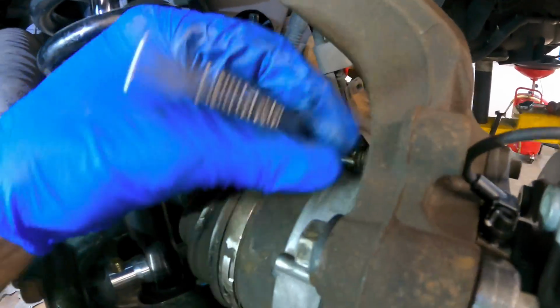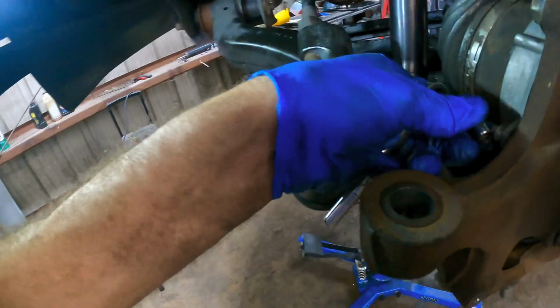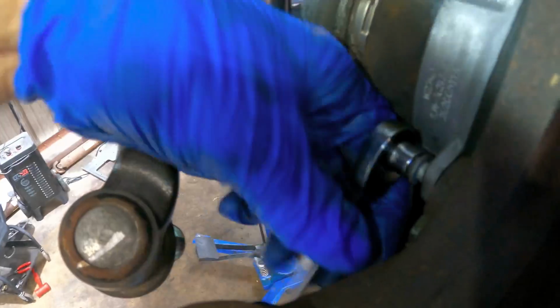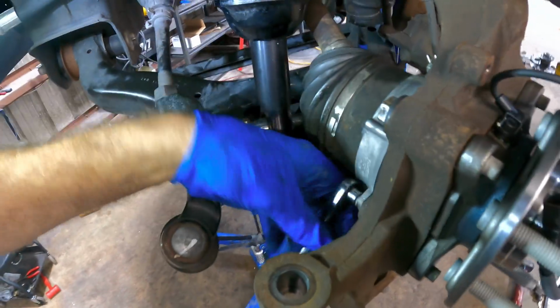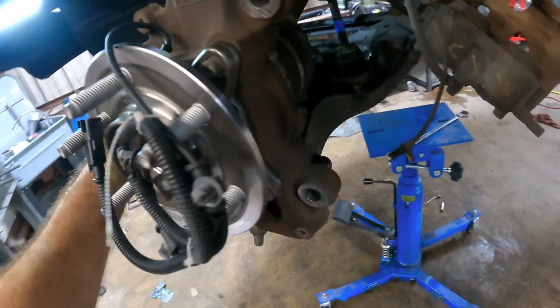I think after I get this guy fastened down, let's see, we've got a vacuum line assembly to hook up, and then I can do the backing plate. Oh, socket gravity. As I was saying, and there is a backing plate. And these little 8mm bolts do not get torqued to the hilt, just snug them up.